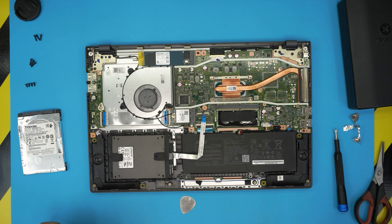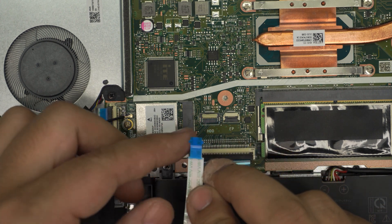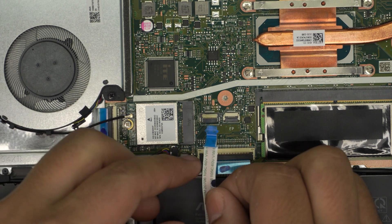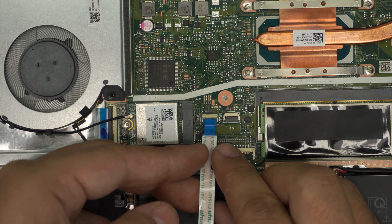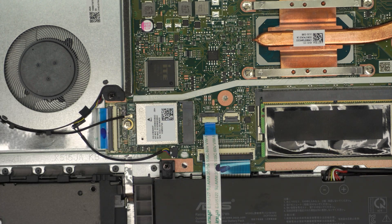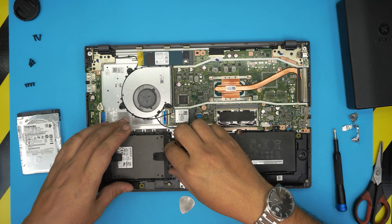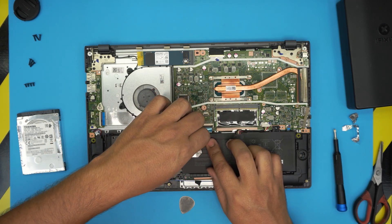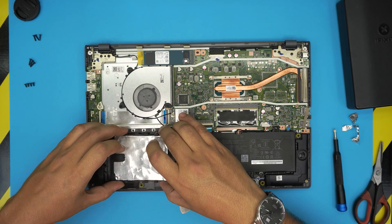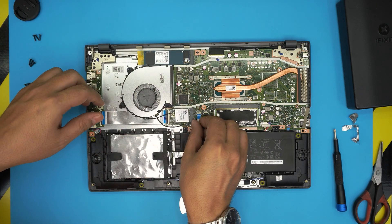To plug in the flex cable, bring it down at a 45-degree angle. There's a tiny earlobe on the side of the flex cable that prevents you from pushing it in straight — you have to angle it 45 degrees all the way into the jack, then push it towards the motherboard and lock it down. This was for demonstration; I'm not leaving the SSD in here. Again, you do not need to remove the battery at all. Bring the drive back, squeeze it in, plug the flex cable at 45 degrees toward the motherboard, and lock it.